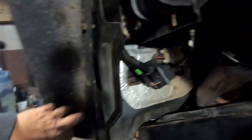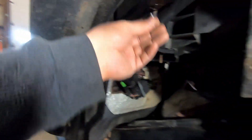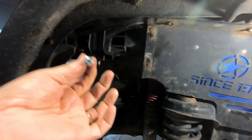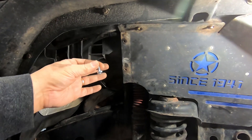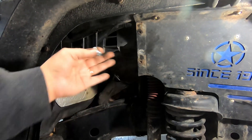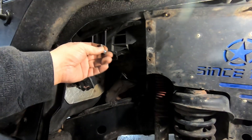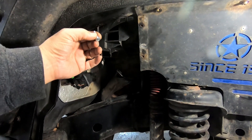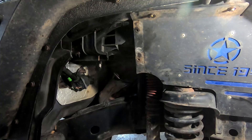On this back side you take this nut off and there's a tab right here - that tab connects to there, so I'm okay there. I just need these three, and I happen to have three Phillips head bolts. These probably are not the best ones to use for this, but it's what I have right now. These are not hardened, so if I have to take this off again later, I'll try to remember to run some PB Blaster in there and maybe put some anti-seize in there to help protect them. But I'm going to throw these back together and wrap this project up.